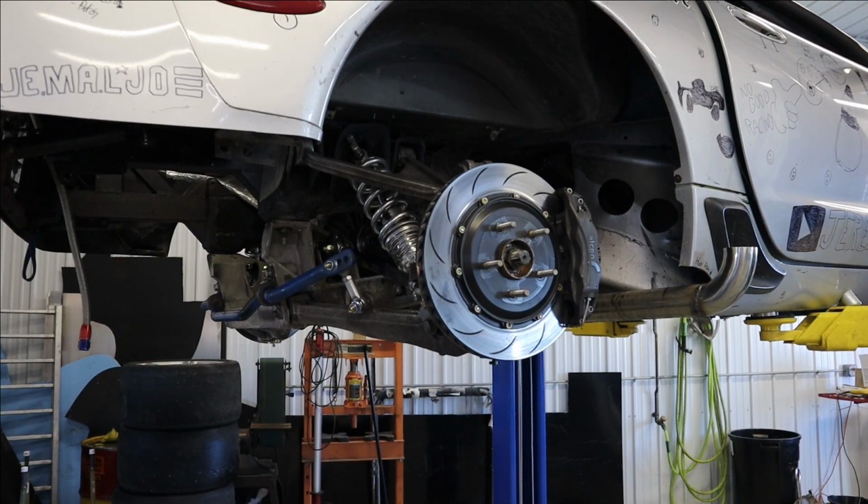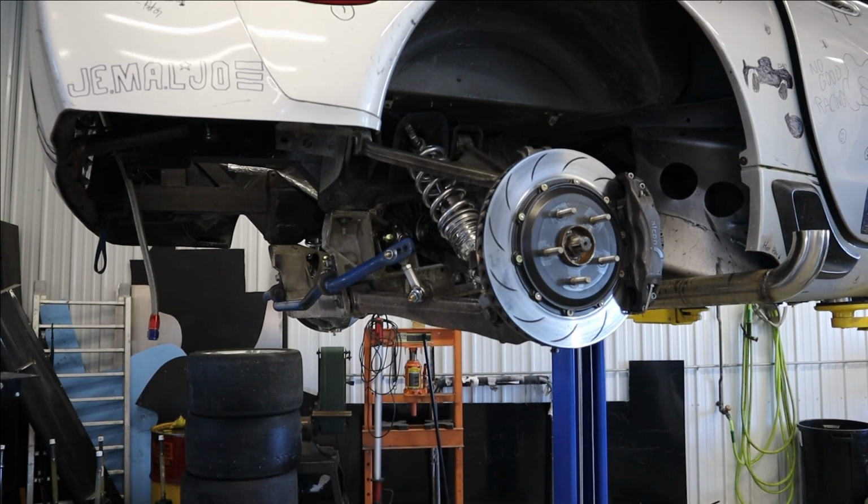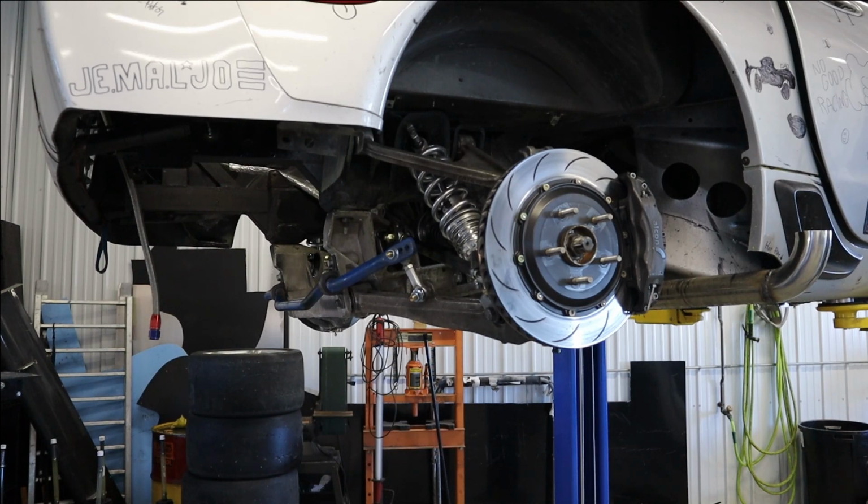We've got the rear sway bar in the stiffest setting. We'll adjust that if we need to at NCM. That's an easy adjustment. The front sway bar, with the lines I routed underneath it, made it a nightmare to change. So I don't want to have to do that at the track, although I will be bringing my extra width just in case it's terrible.